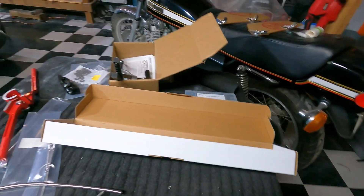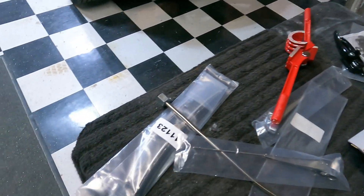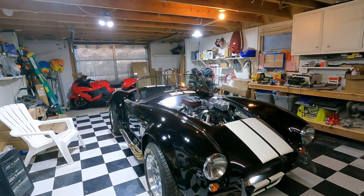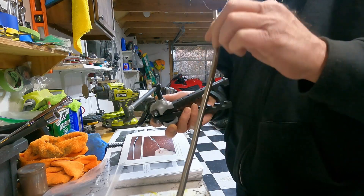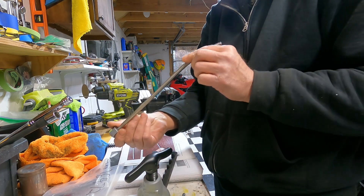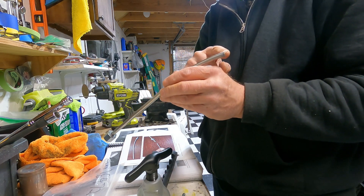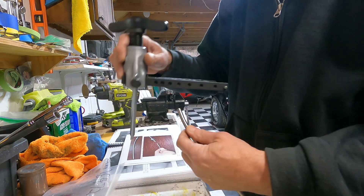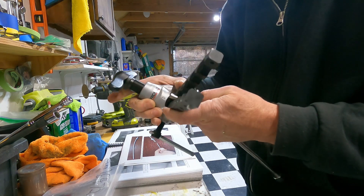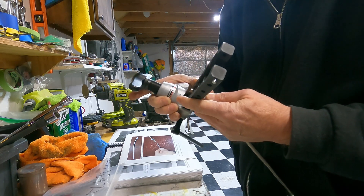This is the tube that goes from the motor up to the first wheel box. I bent this so that it goes in stress-free into the wheel box. I'm going to put a flare on it — left about a sixteenth extra, or marked it, maybe a little more. I've got a little room to work with it.